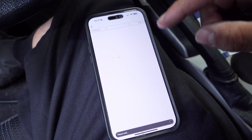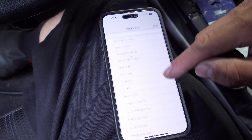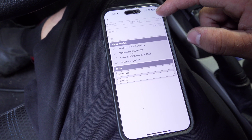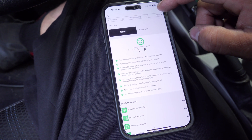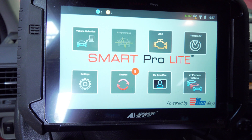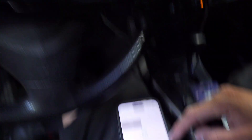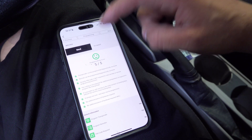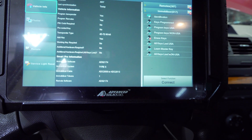This is the same menu options that we went through during the key cutting, so I did it with the Futura Auto. Let's see what programming does here — go to next, next, so I can see my serial number. I'm going to hit send, and it automatically pulls up exactly what I need. I cut the key, went to next, hit send, and you've got everything you need to get it done. It shows that it was accepted, so that's pretty sweet — you can send the job to the immobilizer tool.